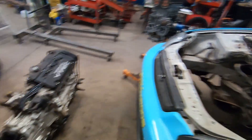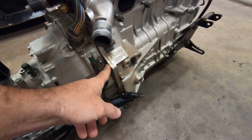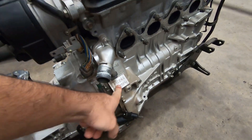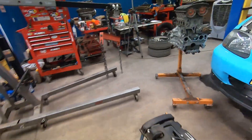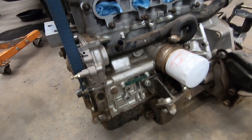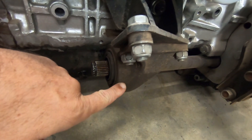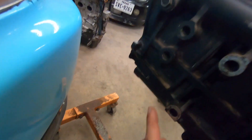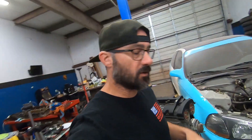We've got the engine out of the EK now, and this is a typical H2B setup. It's got an adapter plate that allows you to mount this transmission to the H-series, along with custom brackets that allow it to go into the EK. One of the things on the H2B swap that people aren't aware of is that you have to trim back the block and the pan in order to get the half shaft to mount up properly. And as you can tell on this one, it was trimmed back right there because this was an H2B swap as well when I had bought the engine a long time ago.